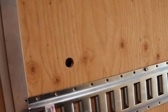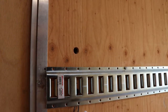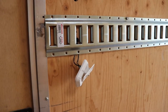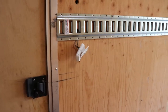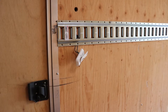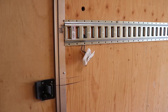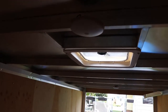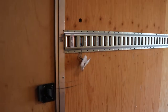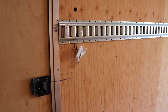Alright, we got through without any damage, so I'll pull the track back and get these wires up through this hole, reattach it to the switch and reattach that switch. I actually leave that on all the time — when you turn off the Jeep it kills the power to the trailer; there's a relay in it. On the van it's got a secondary battery so I don't need to worry about it too much. But I could come in and these lights have push buttons in the centers — you can turn them off if you can't reach the switch. Or just disconnect the trailer electrical, which is a bit hazardous because you wouldn't want to forget to reconnect it and then not have any brakes.